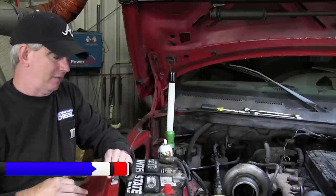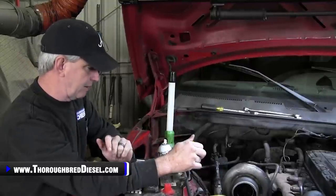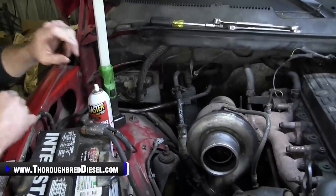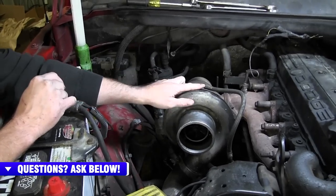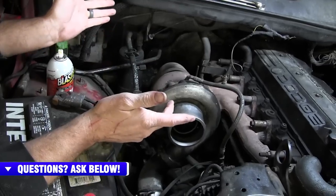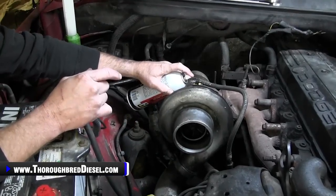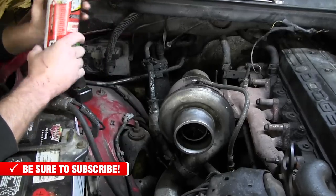Next, in setup on this platform, you're going to be working right around the alternator, so make sure you unhook your battery cables to avoid sparks. We've already taken the air intake out — just unbolt it from the turbo and pull it out. On these Dodge turbos, the feed lines get corrosive on both the oil filter end and the oil feed end. Before getting started, soak those fittings with WD-40 or PB Blaster so they'll break free when you go to remove the oil line.